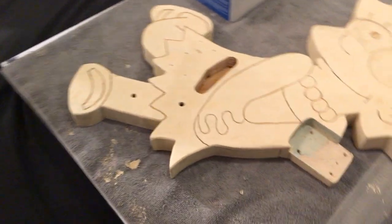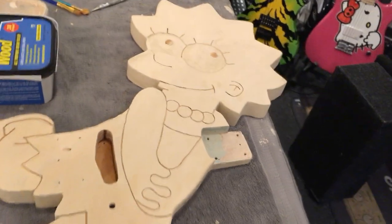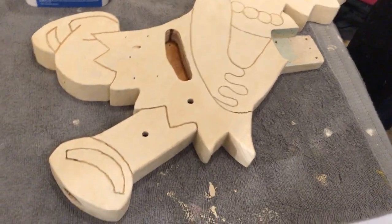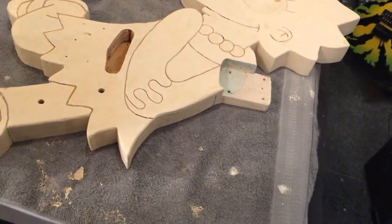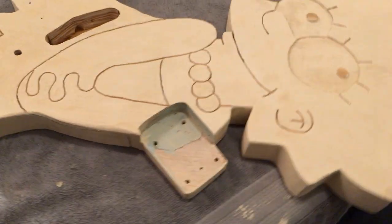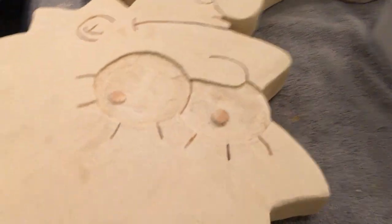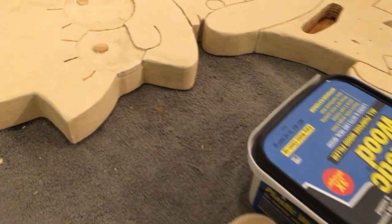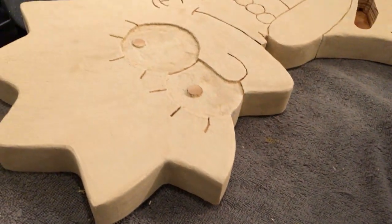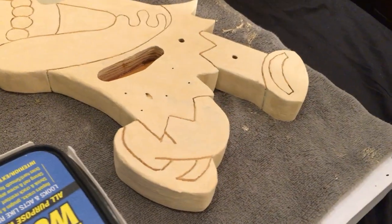And I really love this step, like I've stated so many times in past builds, because it becomes a uniform color. It's an ugly phase, so it's going to be ugly until I sand it and make it smooth and perfect. The whole point of this step is to make the body completely level, flat, and smooth and perfect. So, yeah.